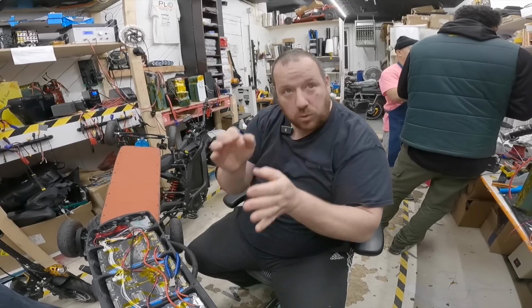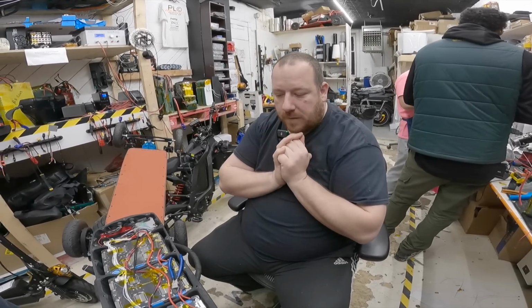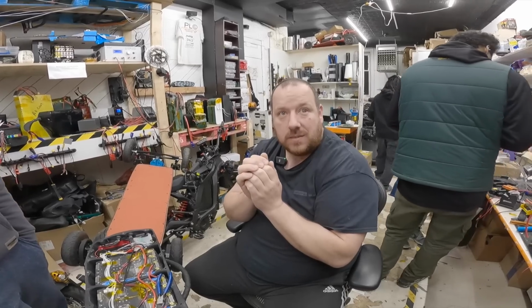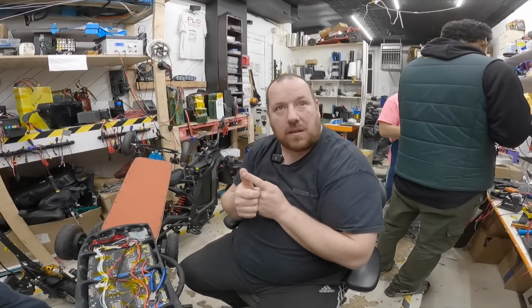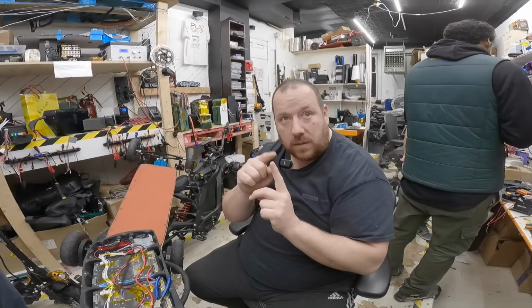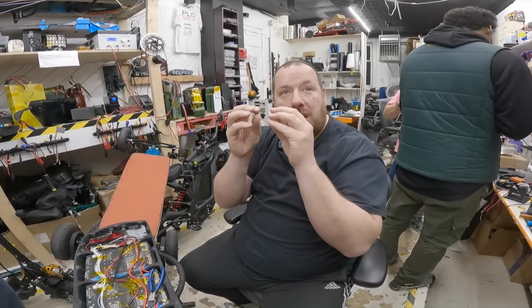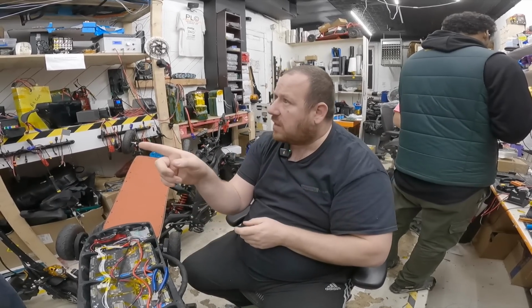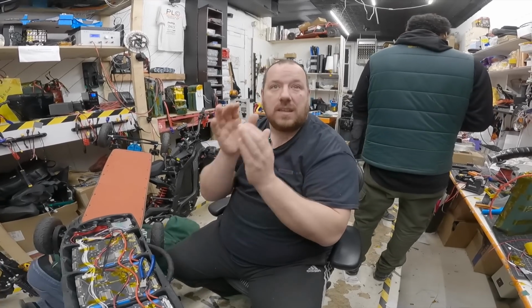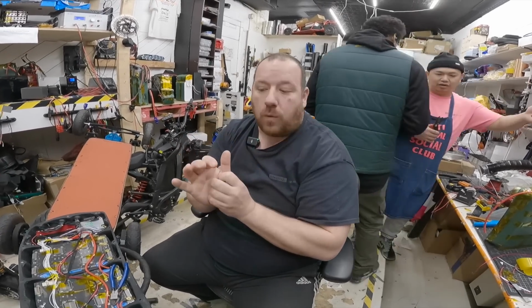That's a long time. We can do that manually. We can lift up the voltage in this particular group. But in this case, we need to find out what the problem is, why his pack is draining down. It can be old cells, bad material, bad build, or a physically damaged cell. If it's a physically damaged cell, that cell starts draining every other cell in that group. In this case, you said it's 5P, 5 parallel cells, and it's enough for only one cell to be dented or damaged. That cell will start draining the whole group, all the other 4 cells, and that's why we have this situation.